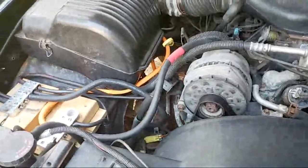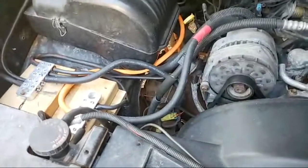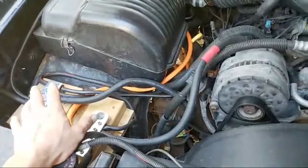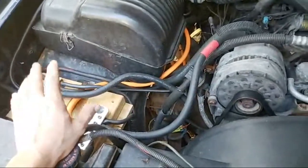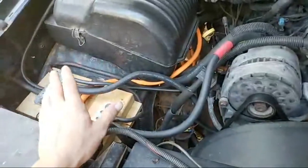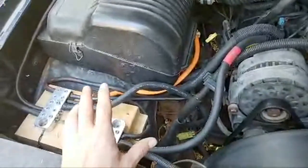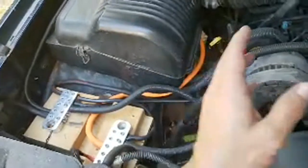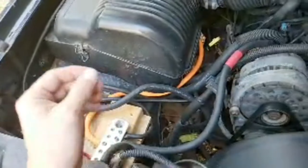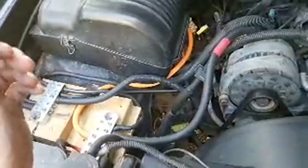I had some questions about doing the battery relocation. One of them was putting a capacitor bank up front — it works fine, so it's totally something you can do. But typically capacitors are placed between your battery and amplifier, not between your alternator and your battery, so there's that to consider.